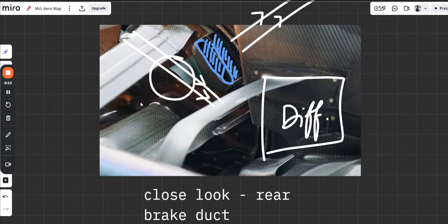So what they're gaining out of this essentially, when they're taking hot air out through the brake duct, is that hot air has a higher kinetic energy than cold air. So this provides you very energized airflow, and when you push it through that diffuser edge, it is highly pressurized, giving you more downforce. Now this is also another reason why they're able to not have tire degradation much. I should not use the word cool. When your brake ducts are efficient, it means you're able to flow more air through the brake duct in a certain cycle as compared to the other teams.